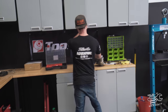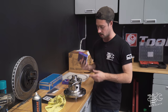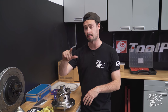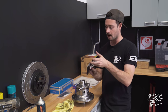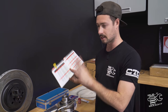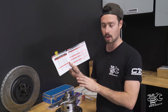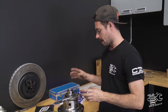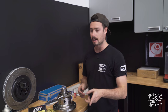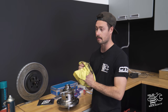It's the Harrop eLocker. I did have to get some bearings to match this for the H260. What we'll do next is press the carrier bearings in and then put the crown wheel on and tension that up. What's really cool with the Harrop kit is it gives you all the bearing cap torque settings and your crown wheel torque settings — I did cross-reference them with the Nissan owner's manual as well just to double check. Then get the crown wheel on, tension that up, bearings on, and start putting it back inside the carrier. But before that, we need to drill the 11.5mm hole for the eLocker wire grommet. I've drilled that and now it's time to put the whole diff center into the housing.